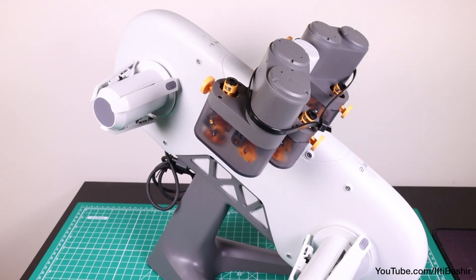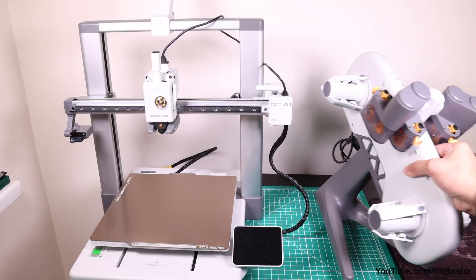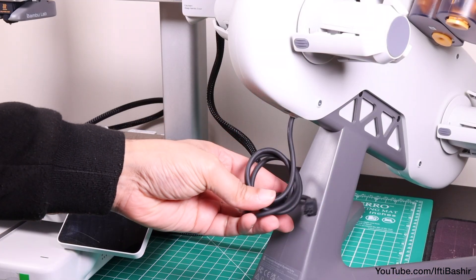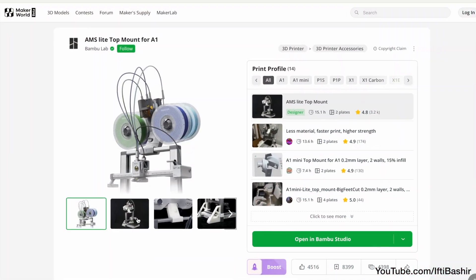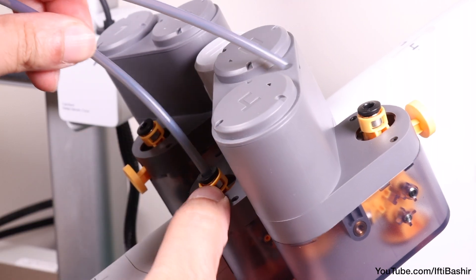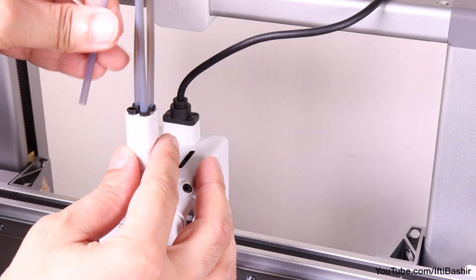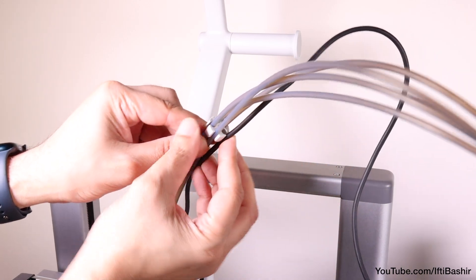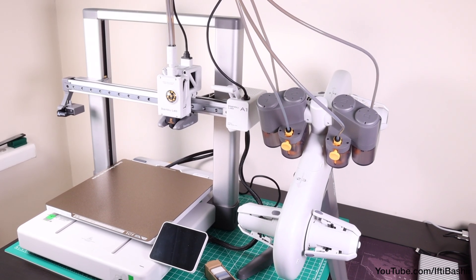It really is that simple. The AMS Lite is designed to sit on the right side of the printer, though you're free to place it anywhere as long as the main power and control cable can reach the rear of the machine. Longer cables and extensions are available online should the need arise, as well as a printable mount for attaching to the top of the printer's frame. We can now proceed to push fit each of the bundled PTFE tubes into the top of the unit and then across onto the top of the printer's extruder assembly. Finally, the extruder's main cable can be inserted into the free slot within the cable organiser to keep it completely out of the way, completing the full A1 combo hardware setup.